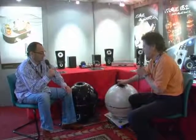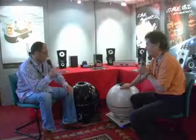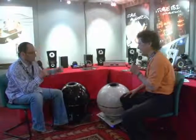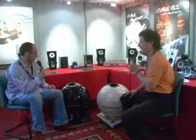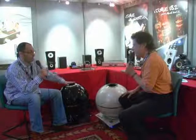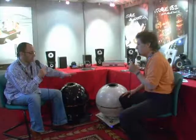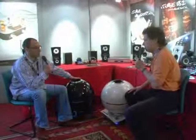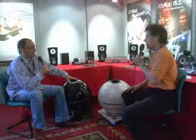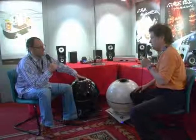Talk to me a little bit about these — these are subwoofers? These are subwoofers. There's actually nothing inside there — this is the port — until you get your hand down there. You do have people who occasionally put their umbrellas in there, and small children put their chewing gum in there. But this is actually a highly specified subwoofer. It's got three amplifiers in there: one 250-watt amp and two 75-watt amps. It's got a 12-inch driver. It's incredibly loud, incredibly responsive, and it's arguably the best subwoofer that we've ever seen or heard.